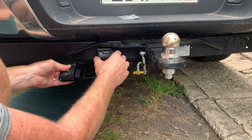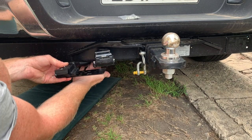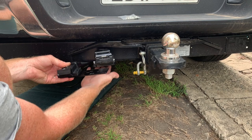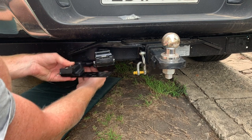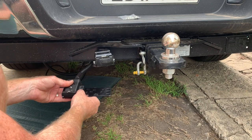We've got a Ford Ranger here. On the Ford Ranger, the genuine Ford harness comes under the bumper and there's a protective guard there, so we're going to follow the original Ford harness. On some vehicles you may come over the bumper and down — that'll just depend on the vehicle.